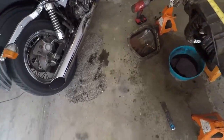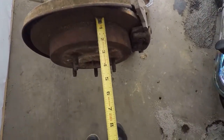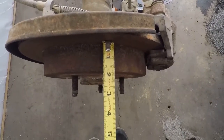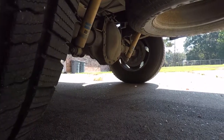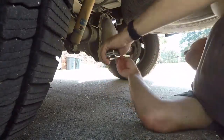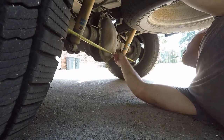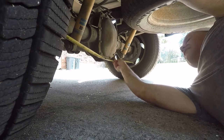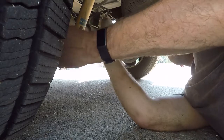One of the things I need to do is measure. All right: 65 and then plus 66 — so 66 and five-eighths wheel mounting surface to wheel mounting surface. Close, because if that's too far off it's going to kind of make a mess of things. It's not going to be the easiest thing in the world to do, but it'll get close. Yeah, I think that's going to be pretty close.